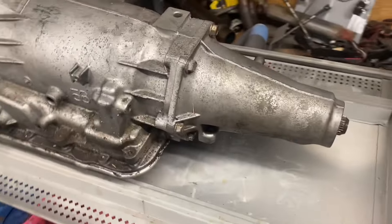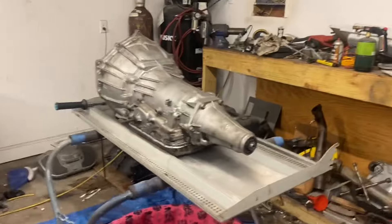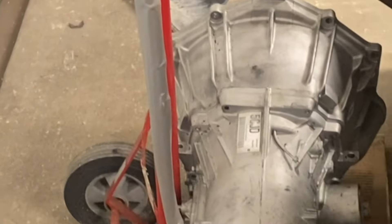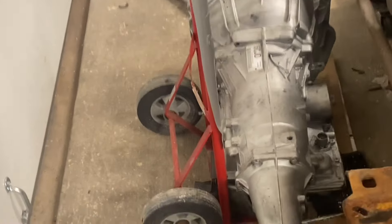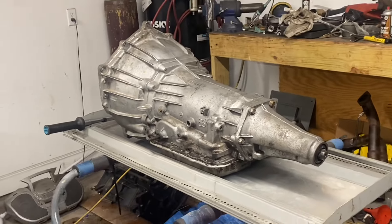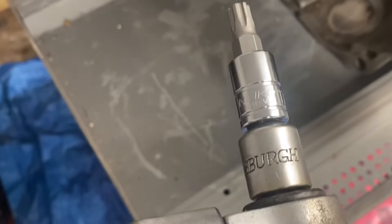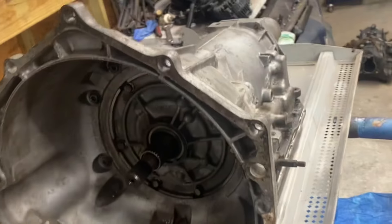Mr. Random here checking in and today is the day we break down the full 4L60E. This is a '99 model that I got off my co-worker's truck — a '95 which I thought might have been newer. You see it's a two-piece shaft. You see that tag right there — that's how you can look them up and see what year it is. They also got that same stamp right under the tail of the transmission. Let me get this flipped over and gather my tools to take the bell housing off, which requires a T50 Plus — not a regular Torx bit. It's a T50 Plus, it's rounded off, not as pointy.